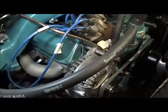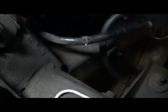The last piece of rubber fuel line that needs to be replaced — we're up in the engine compartment. This is the line that goes to the fuel pump inlet. It comes out of the stub frame. Don't let that temporary line confuse you — that's a temporary line I have going from my auxiliary fuel tank to the inlet of the fuel pump. Normally this would be the line, and it's hard as a rock. Needs to be replaced.